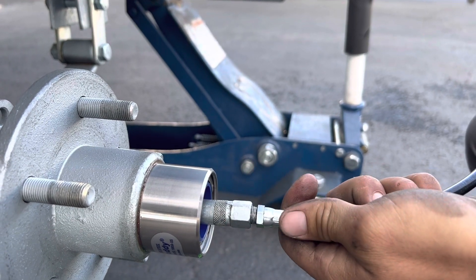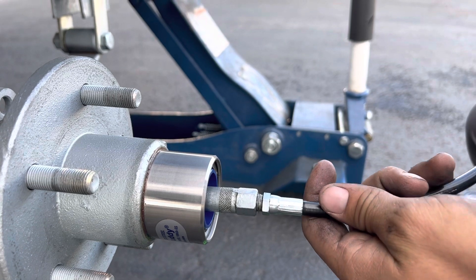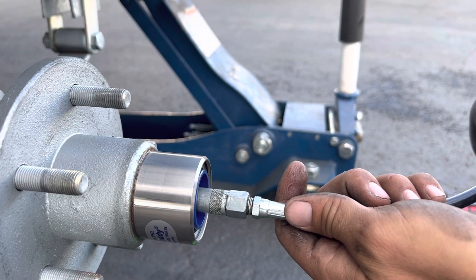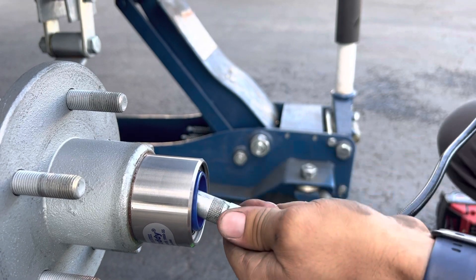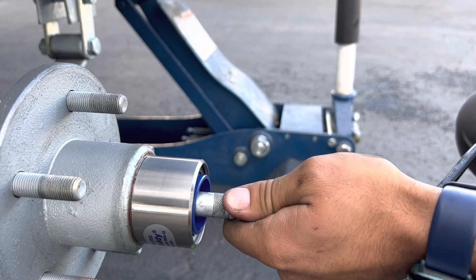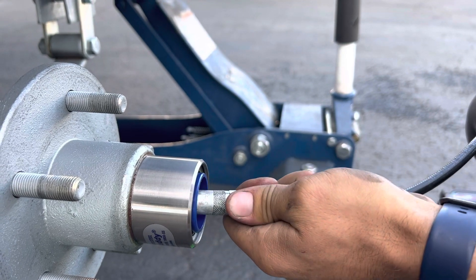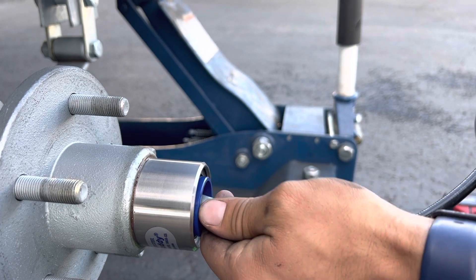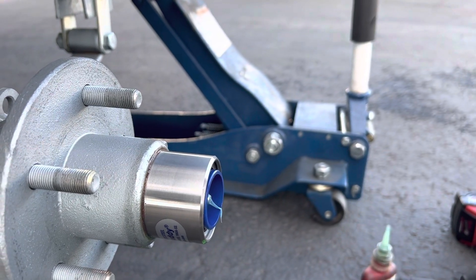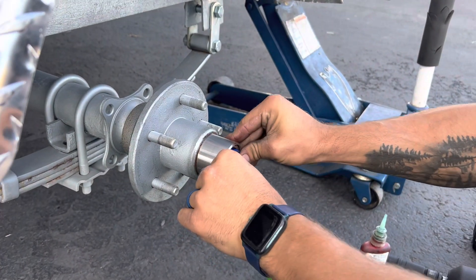As you first fill it, you've got to wobble it around — that's going to let the air out. You see how that sunk back in? So the air goes out and just start pumping again. You'll see that blue ring start to come out again, about an eighth of an inch. Wobble it again to find any air bubbles. Just about there is where I'm going to call it good — it's nice and tight, you're not losing any air. And there you go; now it's just a little wipe up and we'll get the rim back on and you guys are done.